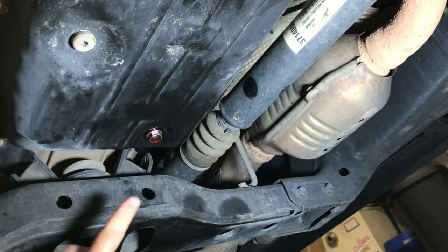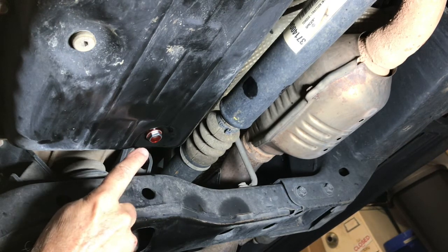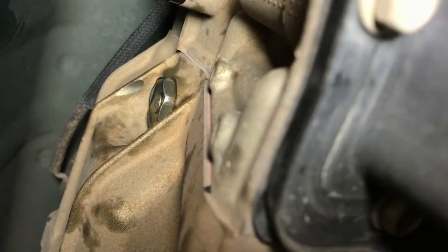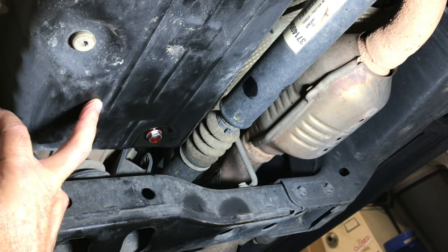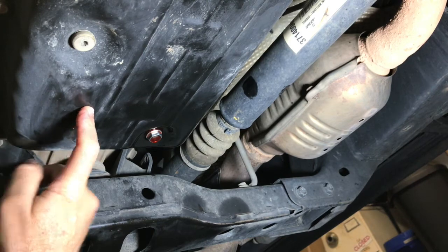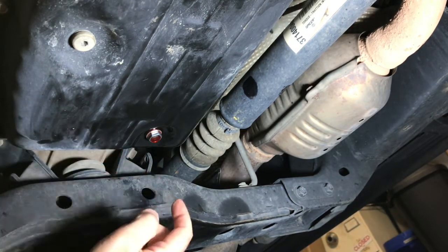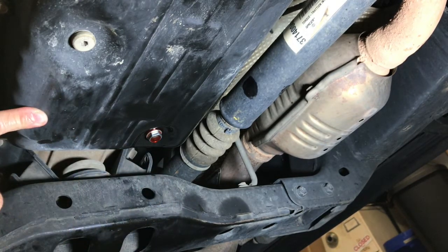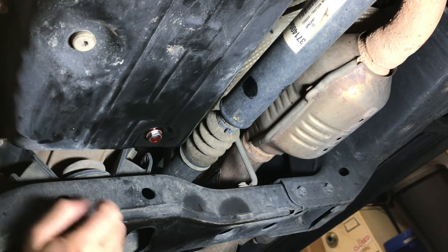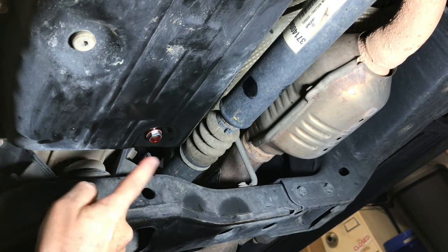Here's the transmission oil pan. That's the plug. As you can see, there's a little bit of transmission fluid seeping through the seal. It is stripped. This right here is the place where you check — it says 'check' right on it — so you check your fluid level. Off camera, that's where you fill it. This is what they call a sealed transmission — there's no dipstick up top. You have to get a hose that goes into this filler cap. We lost about half a quart; I think there's about two quarts in here. I was able to fill it up with a half a quart, so I know I've got enough fluid in here. I know there's a long way of checking temperature to make sure you have the right amount, but for the next couple of days I'm going to just get by with this. So I'm going to wipe that up, put a little alcohol around to try to break up the grease and the oil, and then spray on some Flex Seal and see what happens.